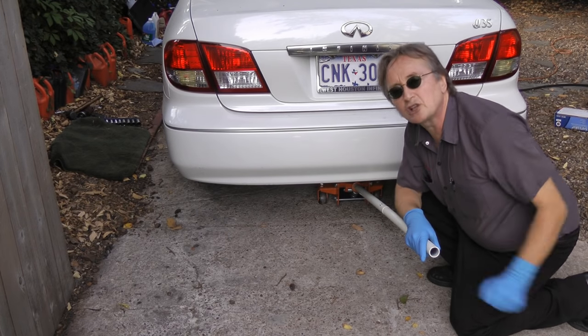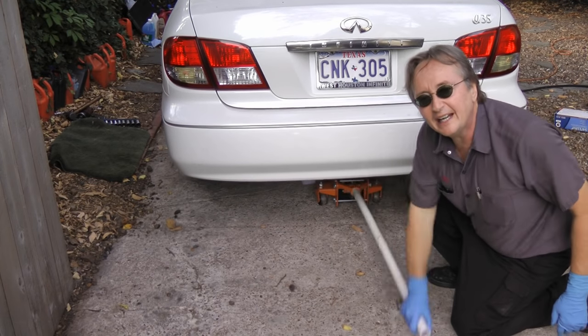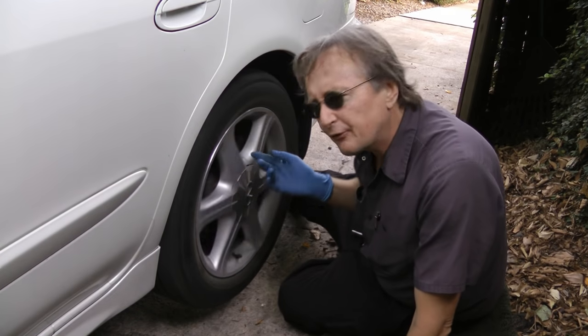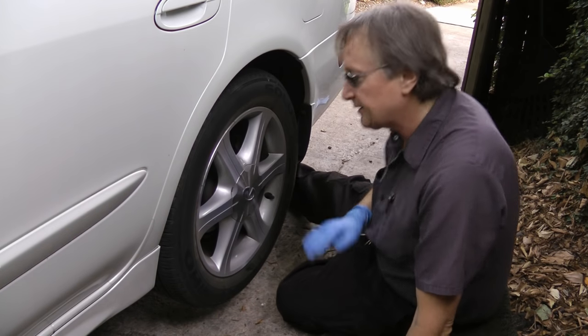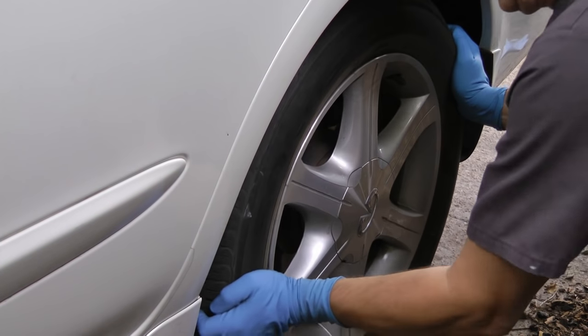In this case the roaring is coming from the back — it sounds like it's behind me — so we're going to jack the car up in the air. It sure sounds like it's coming from this wheel, so let's pull on it. Unfortunately it doesn't have any play; it doesn't wobble when I pull on it. But that doesn't mean the wheel bearing isn't necessarily bad — many times wheel bearings will start to wear out, they won't have any play, but they start to make noise. So you have to pull off the wheel and check them.